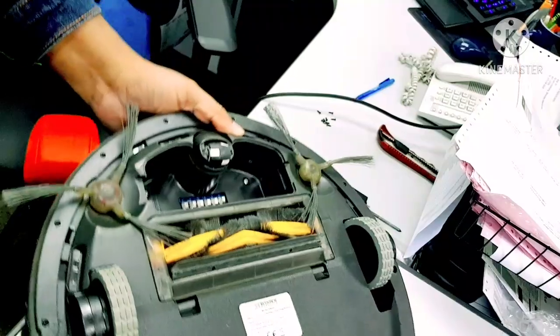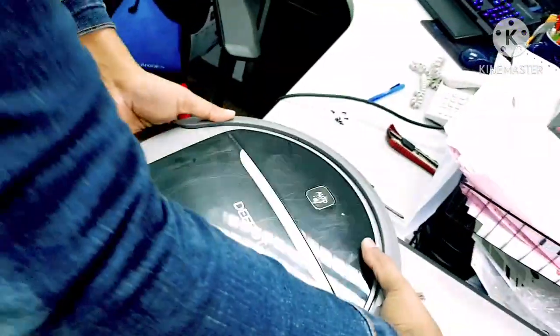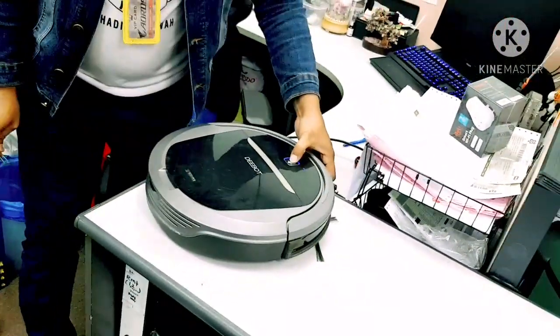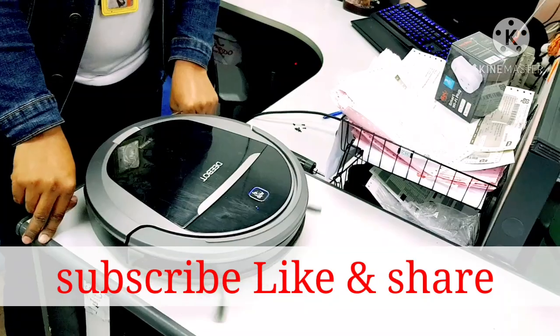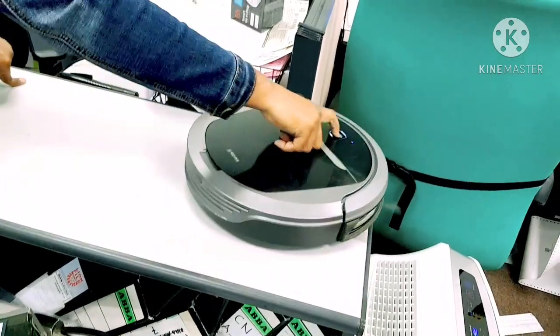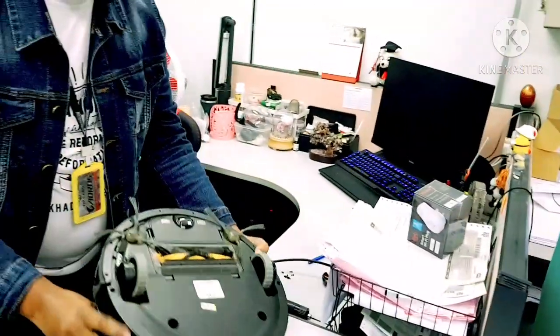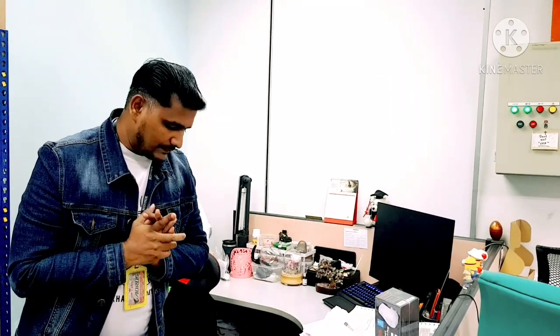Make sure all clips are equal in level. Now put back the battery and press — make sure both sides lock properly. Now let's see whether there is power. I press the button — yes, there is a blue light here and the remote is on, it will function as normal. The issue was simply that the battery connectors were not touching properly with the motherboard connectors, so there was no power. While charging it would also keep giving red light errors if the connectors are not touching properly.